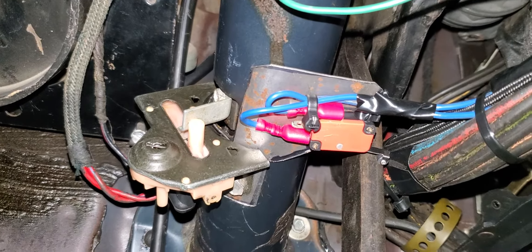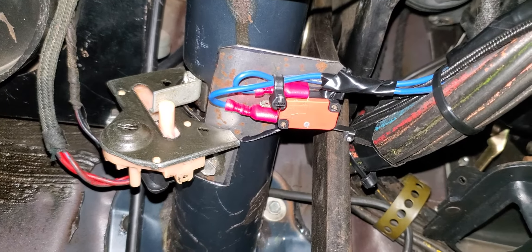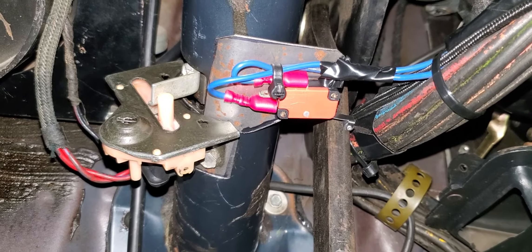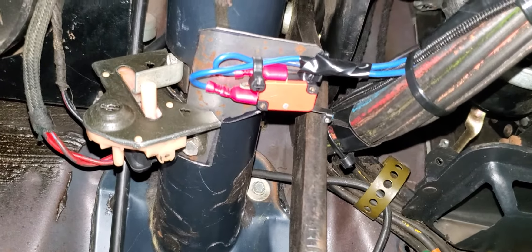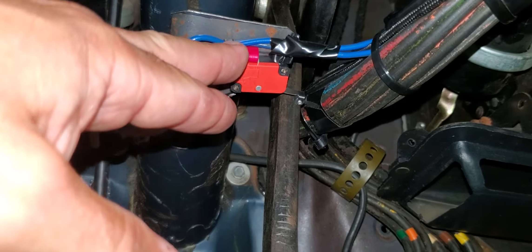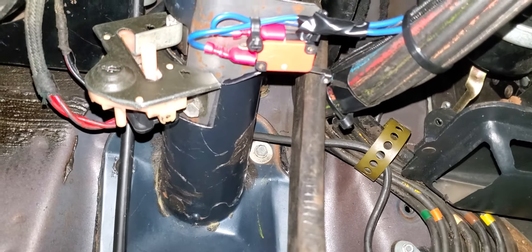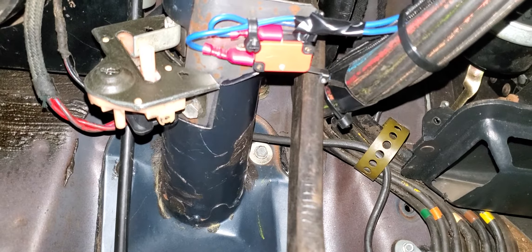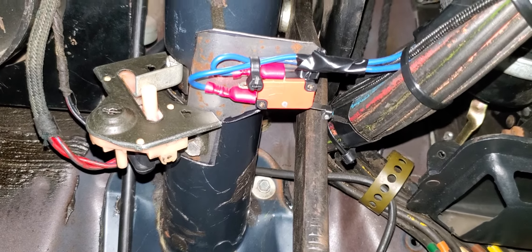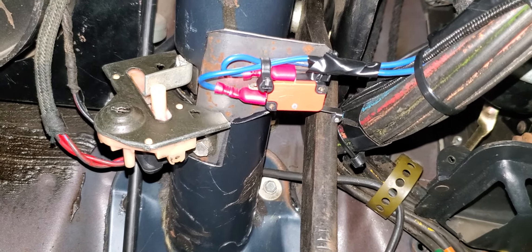This is just version one. I've already got version two in the works. I actually bought a proper AC Delco brake light switch that I'm going to convert to — it'll be here tomorrow or Monday from Amazon, it was like $12. The reason is I don't know what the endurance is of a switch like this. The brake lights only draw 600 milliamps, so there's no reason the brake light switch shouldn't last a long time, but over the life of driving it's probably a fair bit of wear. Plus the clicking of this switch is annoying — every time you step on the brakes having to listen to that click is going to drive me crazy.